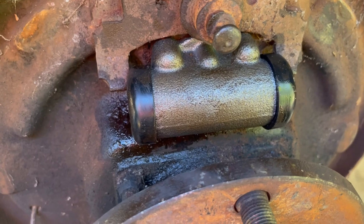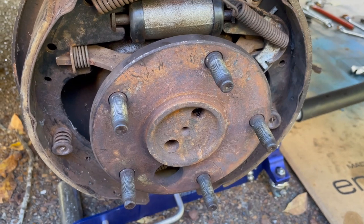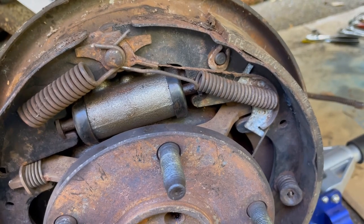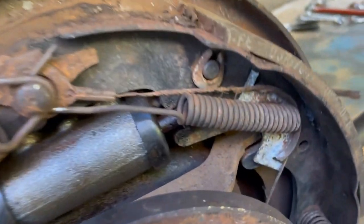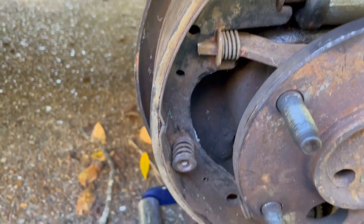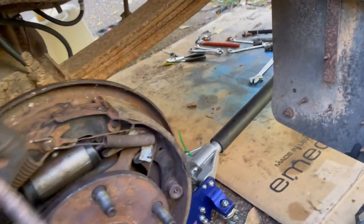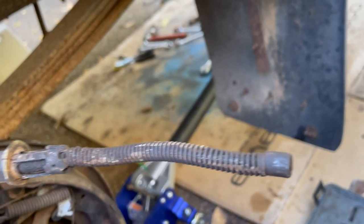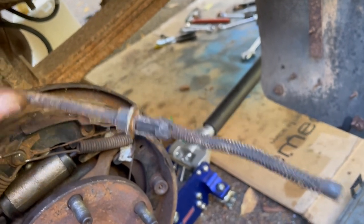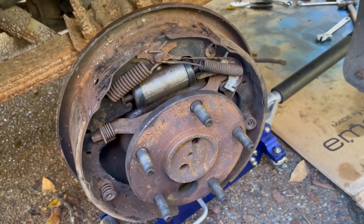Now I need to figure out what I'm going to do about this emergency brake being stuck on. These Fords are a little different - the emergency brake setup and brake adjustment setup's a little different. This weird thing here is for the auto-adjust. What I did was just pull the parking brake cable out for now - it's stuck badly. I'm going to soak it in mystery oil for a few days; that should free it up. But I want to get this thing together for now as it's getting late in the day.